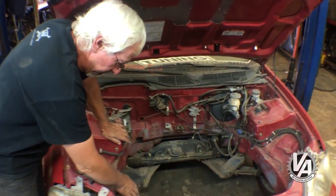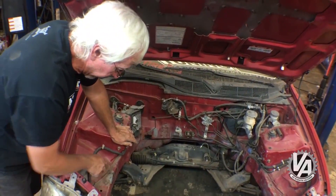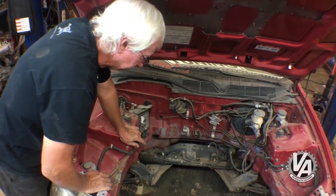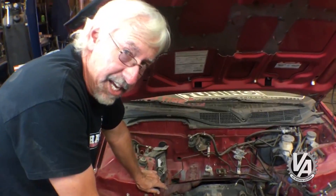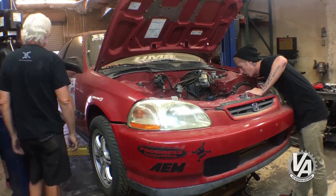Let's move on to trying the motor in the EK. We rolled it in and prepped the engine bay. The EK uses mounts that bolt onto the frame rail, so we just had to unbolt them — no cutting needed, though one was missing part of its mount from a previous J-series swap. We also bolted in an EG subframe because the stock EK subframe leaves no room for the differential to nestle back, which kicks the engine too far forward. We learned this during earlier K-series swaps.